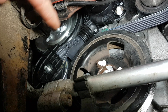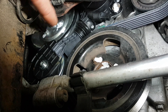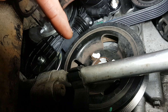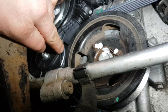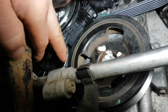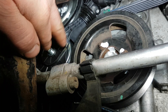What it's actually doing, to comply with emissions regulations, is it stops the water pump from turning when the engine is cold. So on first startup this water pump won't turn until the engine reaches operating temperature, and then as soon as it gets to critical temperature — near boiling point — the wheel will retract back on a worm gear and will basically turn the water pump off the crankshaft.